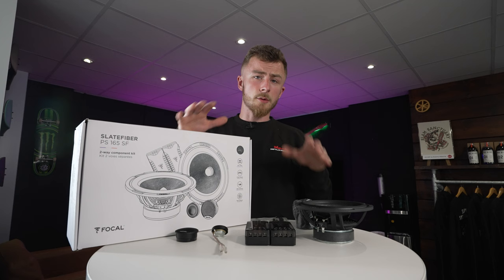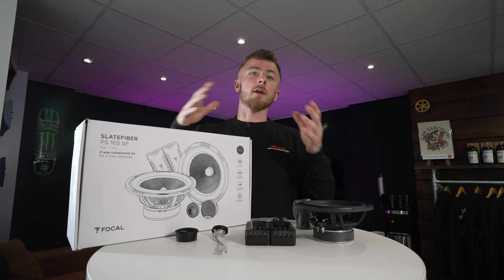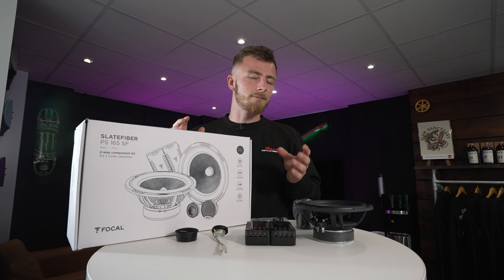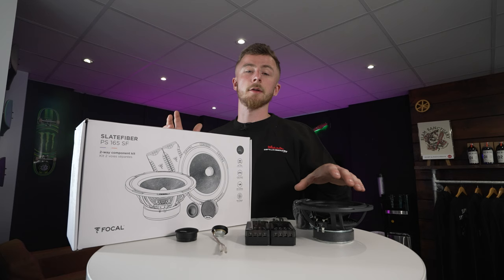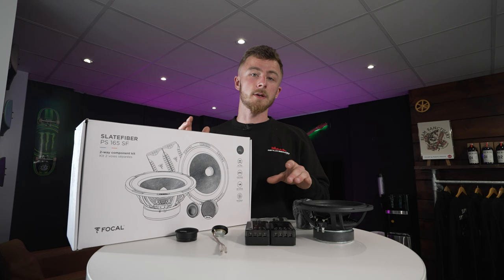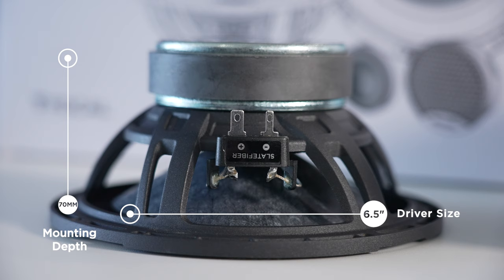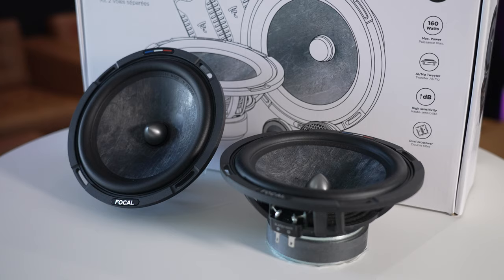In terms of the whole package, the frequency response on these speakers is from 60 hertz to 21 kilohertz — a very wide band of frequencies that allows any kind of music to be played through these at any point. Now 60 hertz is quite low for a six and a half inch mid, and they might be trying to play too hard at high volumes, so we tend to say cut your frequencies a little bit higher than that — but it's nice to know they can play a bit lower. The final impedance on the total system is four ohms, very widely accessible for most car audio systems and amplifiers. The driver is a six and a half inch with a 70mm mounting depth — double check you have enough depth before purchasing. The tweeter is a one inch tweeter.